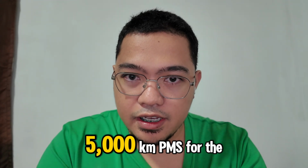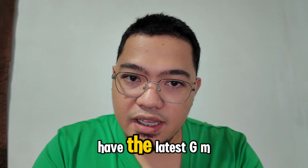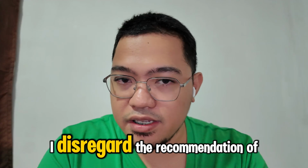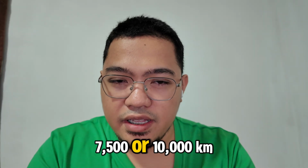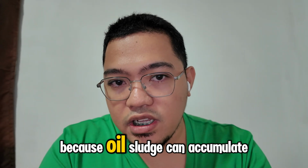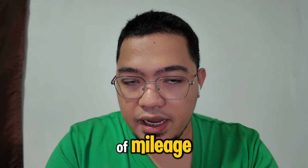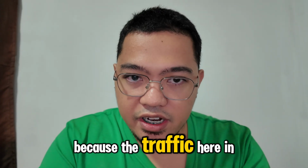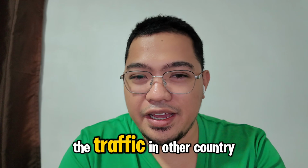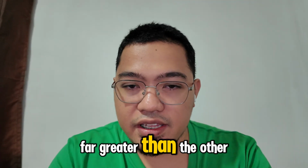So basically, that is the 5,000 kilometers PMS for the Geely Emgrand 2022 model. It doesn't matter if you have the latest Geely Emgrand. I do it myself, and I keep my oil fresh every 5,000 kilometers. I disregard the recommendation of 7,500 or 10,000 kilometers. Any vloggers or mechanic vloggers will recommend every 5,000 kilometers, because oil sludge can accumulate in your engine if you follow those kinds of mileage, even if you are using fully synthetic. The traffic here in the Philippines is very, very slow compared to other countries, and our roads are more congested, so your idle time on the road is far greater.